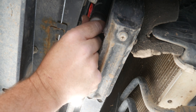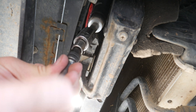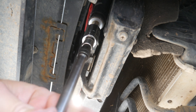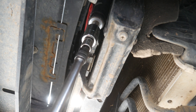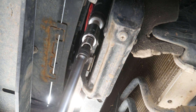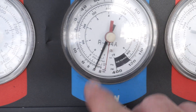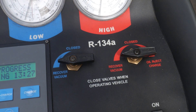Start it by hand. I didn't even look up the torque spec for this — we're just going to snug it up and make sure it's not going to fall out, because this probably isn't going to be a permanent fix. Like I said, this will probably buy them some time, but we are likely seeing some sort of compressor failure or a sealant has been added to the vehicle with a refrigerant charge. Once again, we pulled this down into a vacuum to make sure there's no moisture in the system, no leaks, and then we're going to recharge it to the proper amount.